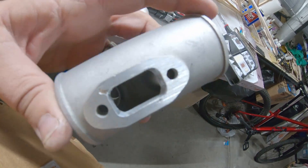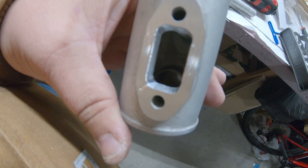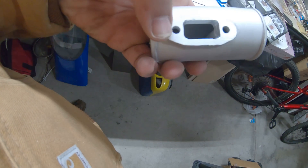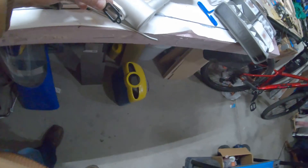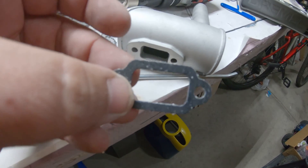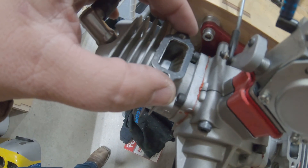That's pretty much done. We slipped a little right here but the way I use the gasket stuff I think it'll work out just right. To give you an idea of how much we opened that up — it's about an eighth of an inch on each end. I just used the gasket, laid it on, lined it up with the holes, and then traced that inside line with a Sharpie, because that gasket matches up almost perfectly with the cylinder.